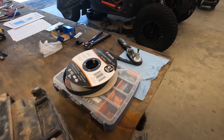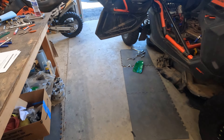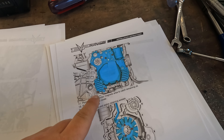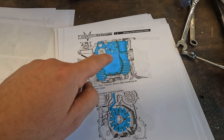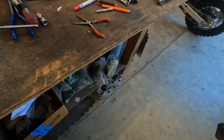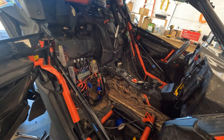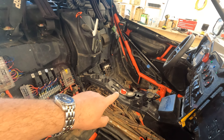Keep all that stuff together. Then you've got 14 fasteners on this cover to take off — you can see them all highlighted in red. I'm going to take that off. I also had to take the driver's side seat out because my magneto wire goes over there to my kill switch, which is required for racing to kill the engine.